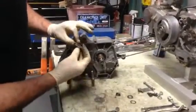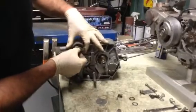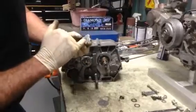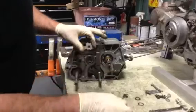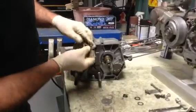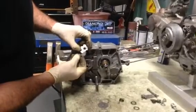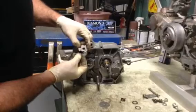If you put the shift plate back on at the detent, it's actually working but it's missing neutral for some reason. I think this would have to be modified — either this pin remachined and indexed correctly — so the shift drum stopper will index correctly, because right now it's going too far and missing neutral and skipping second.